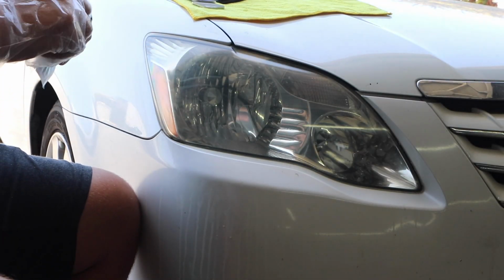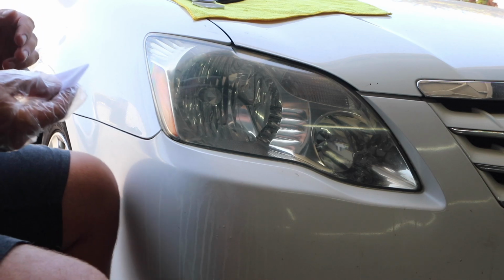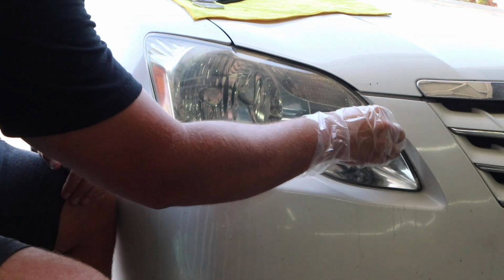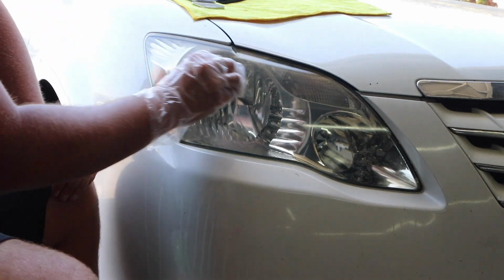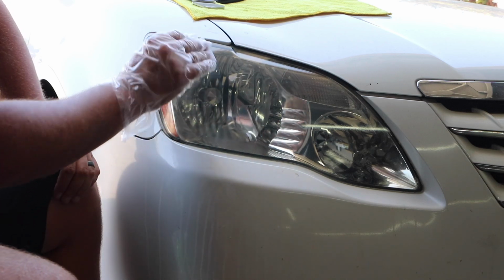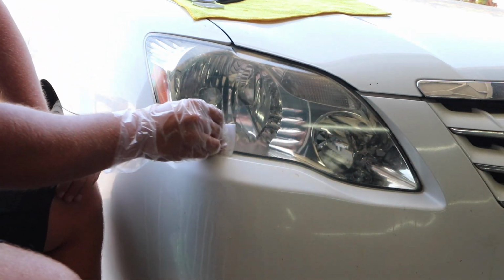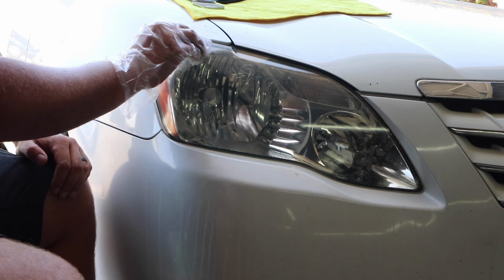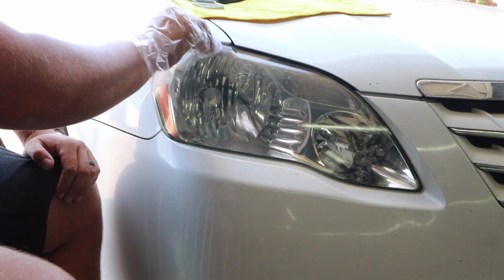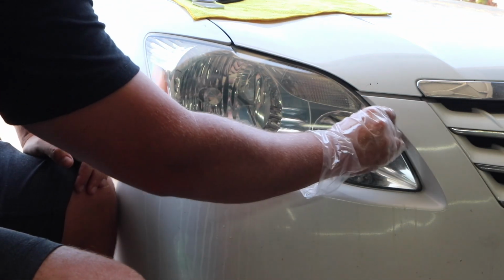Dried up, so now I'm gonna put the sealing wipe on there, and what I'm really hoping with the sealing wipe is that it brings in a lot of that depth and clearness. I'm actually gonna keep it folded. And it's doing kind of what I was hoping it would do, and it seems a little thick. So you want to make sure that you don't get any white marks, that you do it fairly evenly, but it feels like a thick coating. Feels good, feels really thick. And it did actually add a little bit of clarity to the lens, which is cool, and what you will normally see when you put a regular coating on it too, is a little bit of restored clarity.